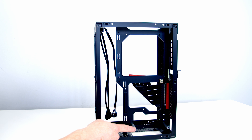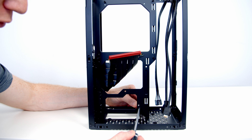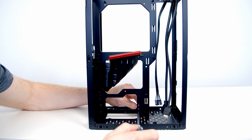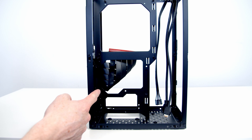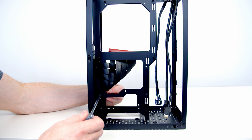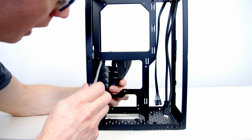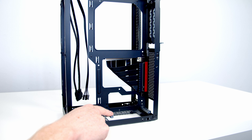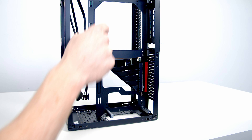Let me show you how to adjust this. There's a screw on the back of each rod — here at the bottom our screw is in the middle hole, with a hole below and above. I'll remove the screw and bring the metal rod down to the bottom hole, then do the same with the other rod. Same thing with the riser cable — remove the screws from the bottom, slide the riser cable down to the bottom holes, and re-secure it. Now the metal rods and riser cable are all at the lowest setting, giving us maximum graphics card length.